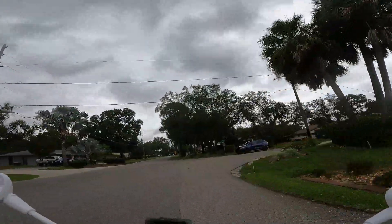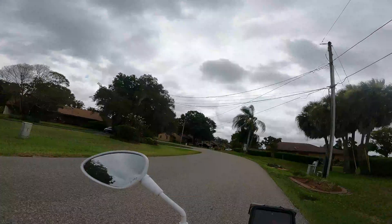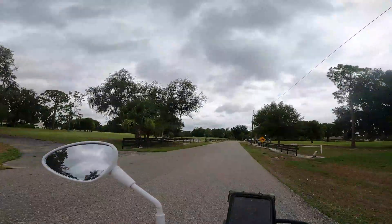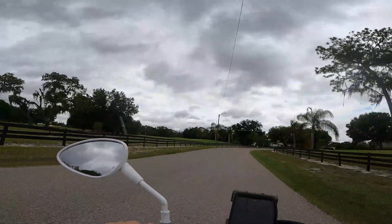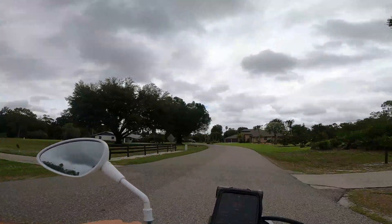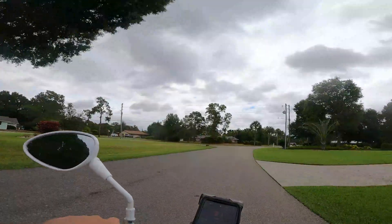Now that I'm lugging it down, you can hear this bog — right there. So I probably need to richen up the idle jet and maybe the needle position also. Now that I've got the bigger piston in it, you can tell it lugs down right there when I take off. It's probably too lean — it's more of a pop and a backfire, usually a lean condition. So I think I have the carb too lean on the bottom. It doesn't affect the top speed at all, so I'm not worried about it now. But this still has the old pilot jet and needle setting from the 49cc.